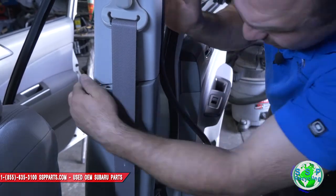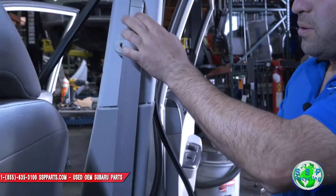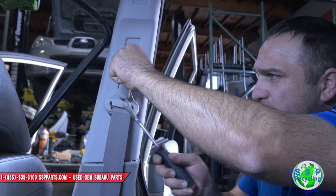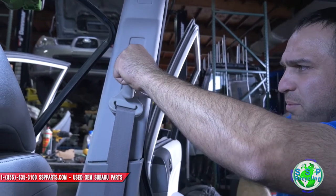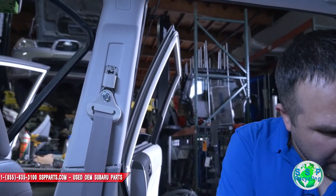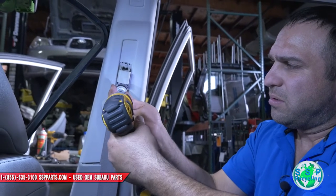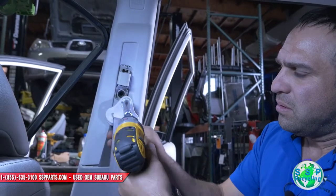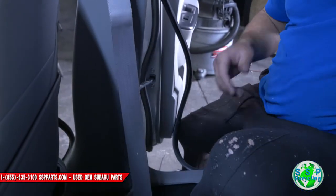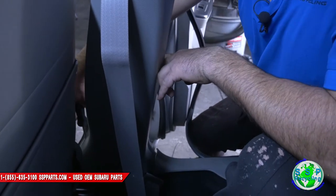This one doesn't want to come out easily. That part is loose, but don't take that piece apart — take this other one apart. Leave that there. You can literally just stick a clip remover and move the top part, because this is the pain to put back in. I'm going to take my 14mm and take this bolt out. That loosens things up and we can get this panel out. There's one green clip here and another green clip right here.